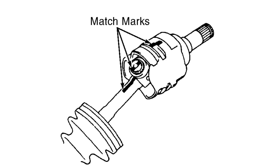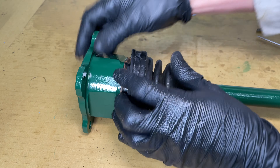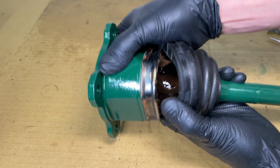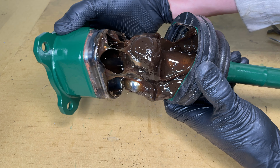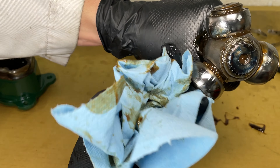I forgot to do this, but Toyota recommends marking the outside of the CV joint as well as the inside so you can match the wear patterns between the tripod joint and the tulip. Grab the big part of the inner CV boot and pull it off the tulip — that's what the big outside piece is called. This one doesn't look like a tulip, but the front ones do. It just slides off. The next part is just wiping as much grease as you can with a lint-free paper towel.